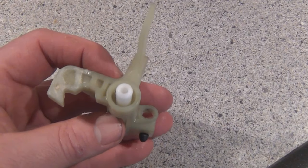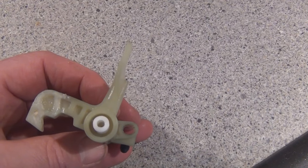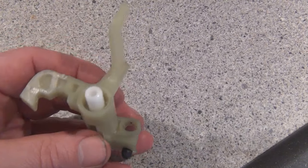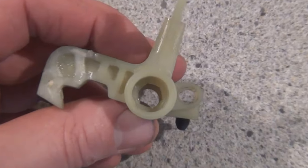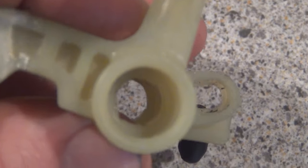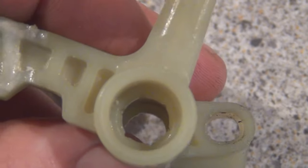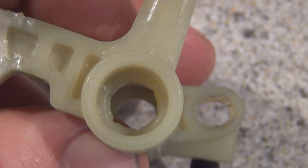I'm going to think of a solution. The worst case is I'm thinking the shaft isn't worn — it's the pivot that's worn inside there, because there's not much of a solid barrel. Just that slight ring inside gets worn, and that's why the first couple of years I owned the vehicle it didn't make a sound, but then that thin wall wore down.